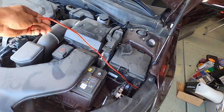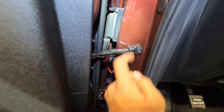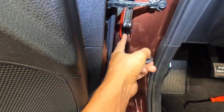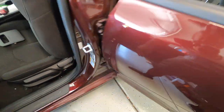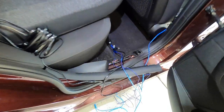Quick update on how we had this wire land: we have it in the engine bay now. There's actually a space between the fender and the inner chassis of the vehicle, it comes down nowhere near interfering with the door and the hinges, then all the way down behind the connection. There's actually a little opening inside the cabin — a little rubber-looking grommet. I'll just cut a groove into it so the wire will sit on the grommet rather than on the metal. On the other side there's another larger grommet, same thing — cut a groove, follow it down through the side. We used that same large zip tie to feed up underneath the back passenger seat and back up and out.